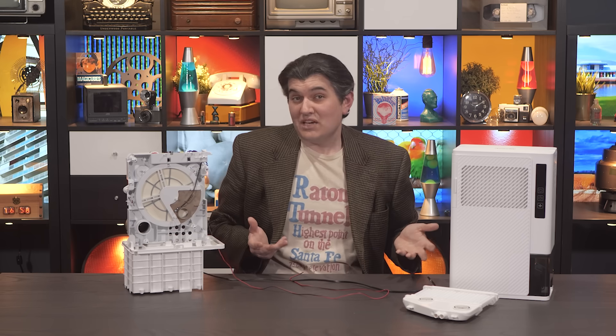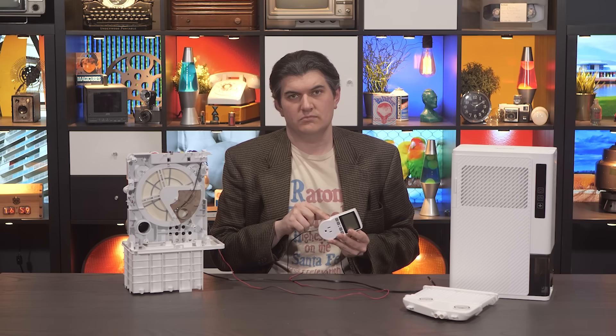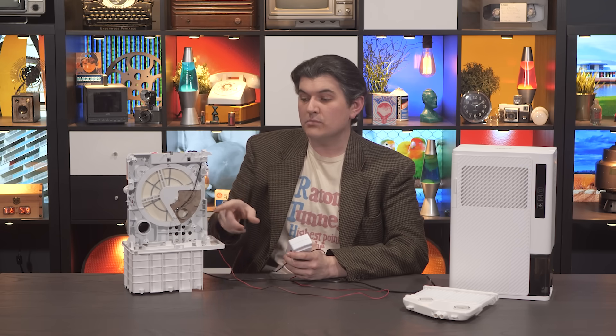I had no idea how much moisture the silica gel could reasonably be expected to absorb in 80 seconds, but I just wasn't convinced that was enough time. So I got my temperature controllers — you may remember these from the HVAC system sizing video — and these happen to have a duty cycle control mode. So I set one of these up to run for four minutes on and then four minutes off. I disconnected the wires from the heating element and the blower motor that actually pushes air through here, and I'll explain my reasoning there. And I wired them to a plug and plugged it into this.